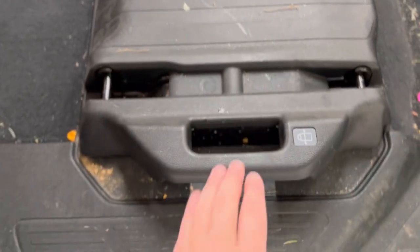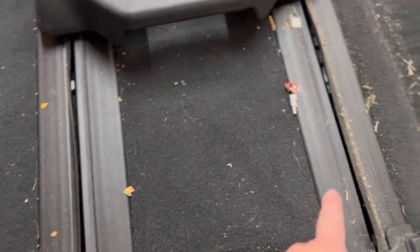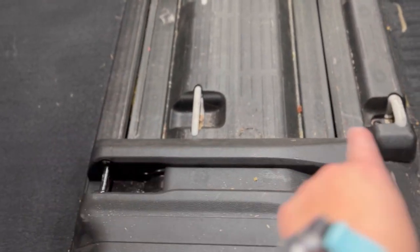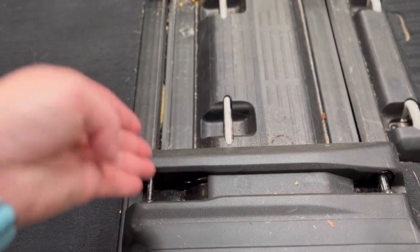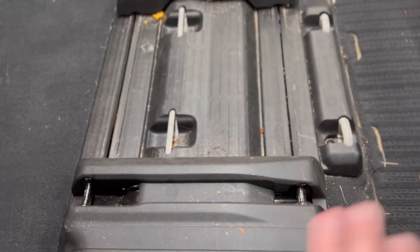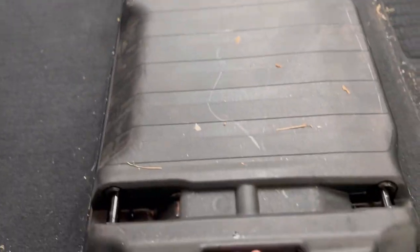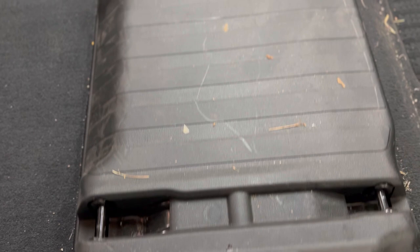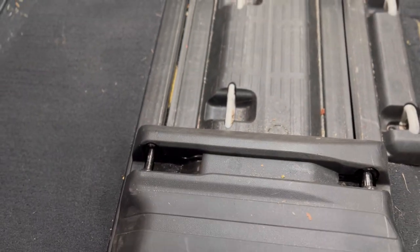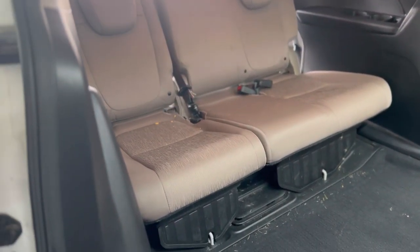This is a newer Odyssey, and we can actually slide the seat all the way over to clean the seat tracks. Some people tackle this with steam, but there is actually grease within these seat tracks. We're going to use forced air or a vacuum and a detail brush crevice attachment to suck up as much as possible. I don't like blowing a lot of liquid within the seat tracks because I don't want to remove that grease — it's going to make it really difficult for the seat to slide. But you definitely want to clean it because all that dirt and crumbs, if they build up, will gum it up and you won't even be able to slide your seats.